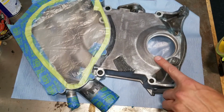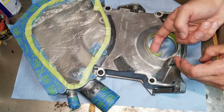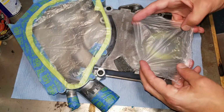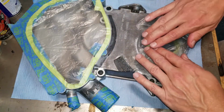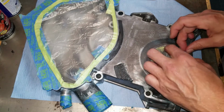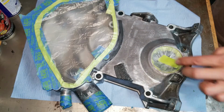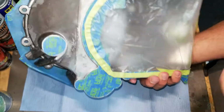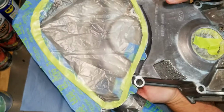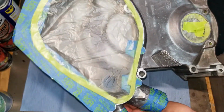So for this, I'm going to back tape with my green tape. So I have a piece of my easy sheet. I'm just going to push in there. I'm just going to fold it in to the middle. And tape it in there. And there we have it. We're all masked. Final step is a final degrease. You want to get all your fingerprints off of there, and you can prime it, shoot it, take the masking off, scrape our edges. Good to go.